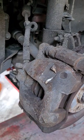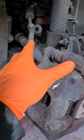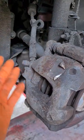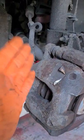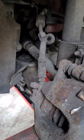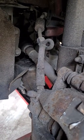Undo these two bolts, twist it off. I've put calipers on before and this has happened, but I've taken them off straight away because you've twisted it before you put it on. This happens, but it doesn't happen where it should stay on the car. Always, always check your work, because seriously, your life could depend on it.